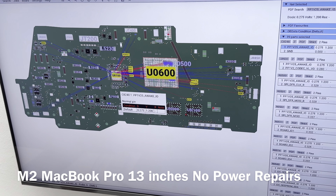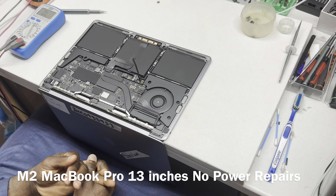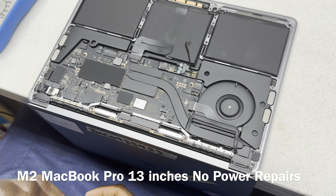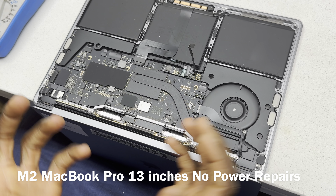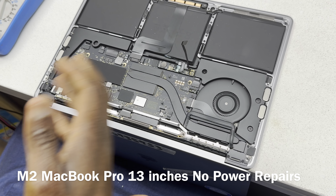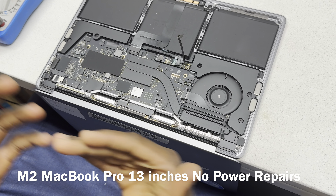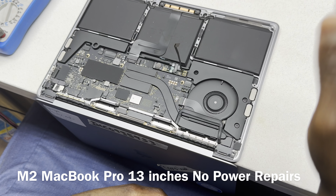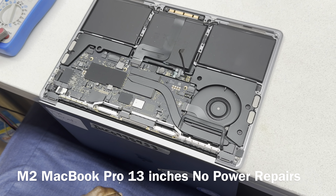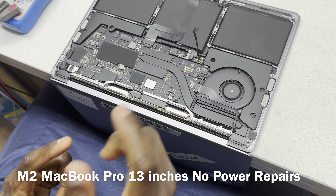Something to be aware of — in terms of the M1, the MacBook M1 follows a similar measurement pattern with the MacBook Air. If you get 12.0-point-something, that tells you that you have a 20-volt on a PPTC. If you get 12.33 or higher than that, then you most likely have a 5-volt on a PPTC.